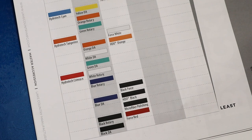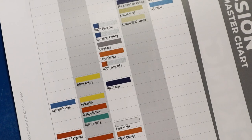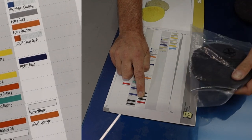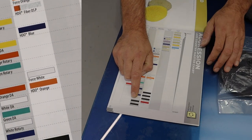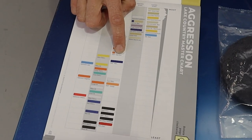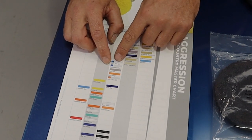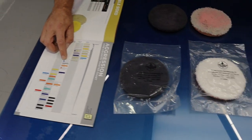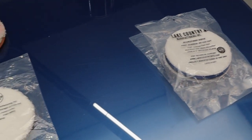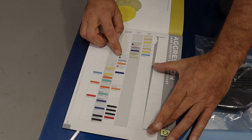If I bring you over to this chart — we come down the microfiber pad range here. So we've got the least aggressive to the most aggressive. You can notice here the microfiber — this black one here — is actually very, very low down, almost a finishing pad. Whereas this one-step polishing pad is really, really high up. So the other two we've discarded — the heavy duty and the standard heavy cut — they are these two here, which are right up at the top range, like two-thirds, maybe three-quarters of the range up. So they're right next to where wool pads start.